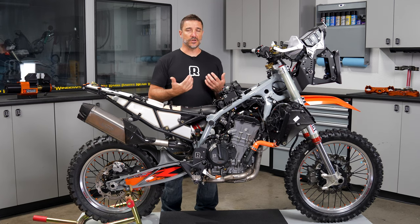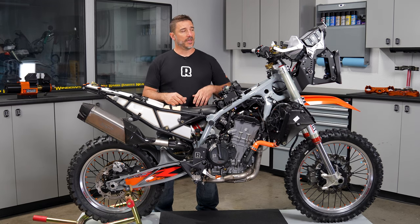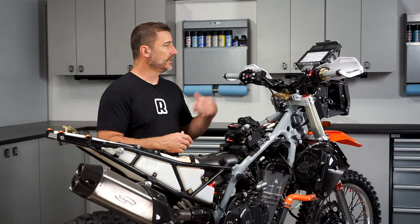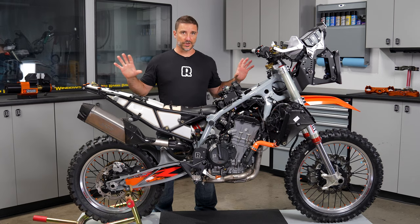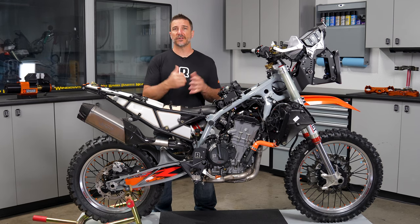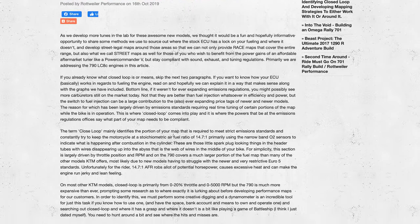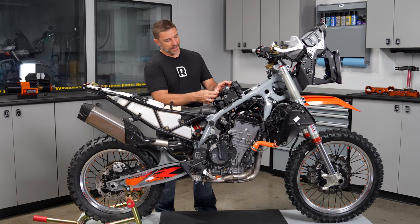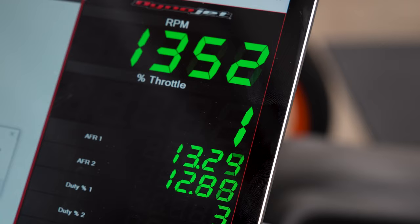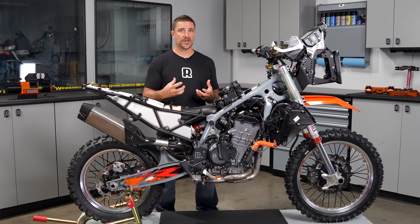On the mapping side of things, we use Dynojet products. We have race maps and street maps. If you want to retain cruise control and avoid an engine light, you go with a street map. On this race bike, we went with a race map — we disconnect the O2s and completely remove them from the bike. You get a permanent engine light and lose cruise control, but you get full control over the mapping. It's about 50-50 depending on the rider's preference. We put a Power Commander 5 on here — it's a mapping module that intercepts signals the computer sends to the fuel injectors and modifies them plus or minus a percentage. We can send them out pre-mapped with different maps; we have tons for both 790 and 890.